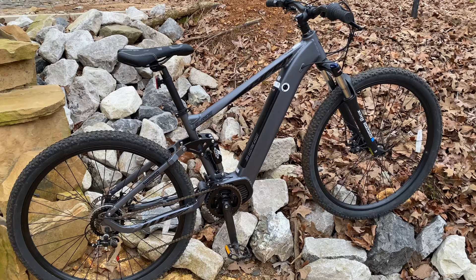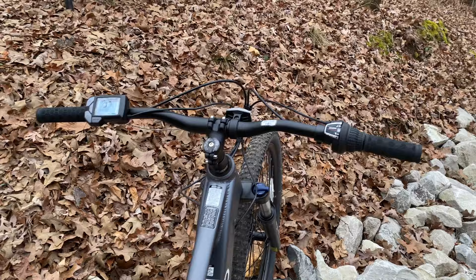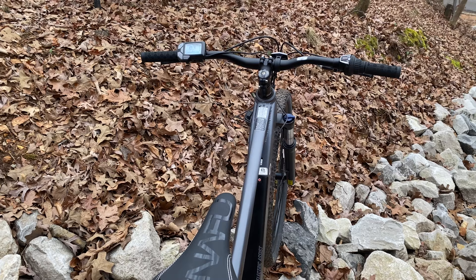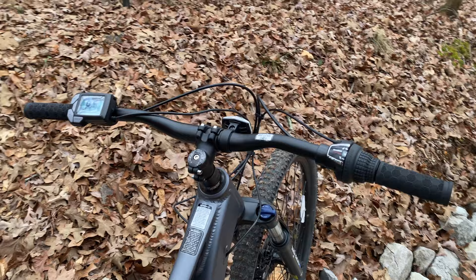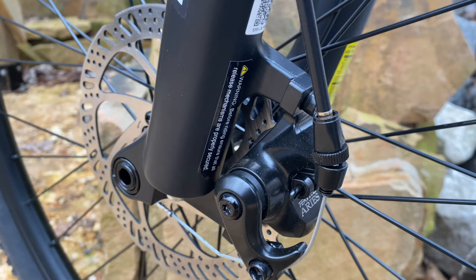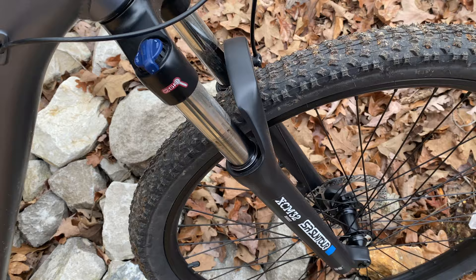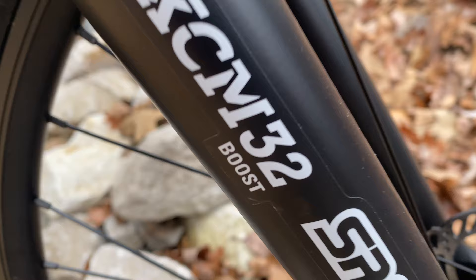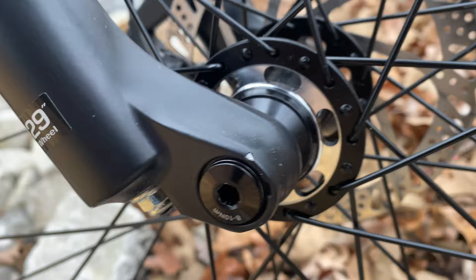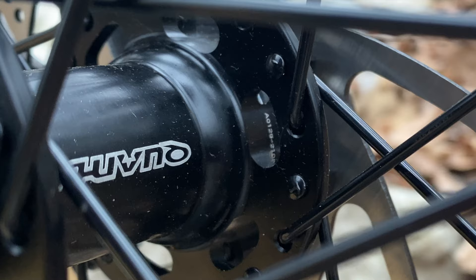Now that I've had the ride, let's look at what I like and get a final determination. The fitment is good; the 720 millimeter bars inspire trail confidence. The Neko headsets — I've ridden these on many Hyper bikes and really like them. The disc brakes: yes, they're not hydraulic, but they are Tektro Aries and they stop the bike quite well. Don't underestimate good mechanical disc brakes — important on a bike that weighs 55.2 pounds. The Suntour fork meets my minimal acceptable level for green trail fun. The boost up front is a bonus.